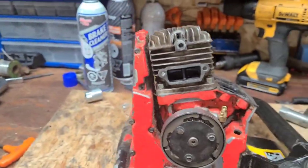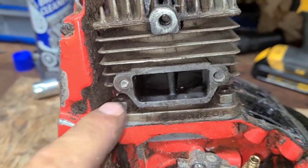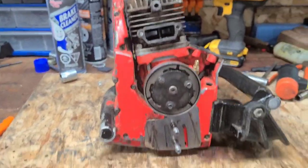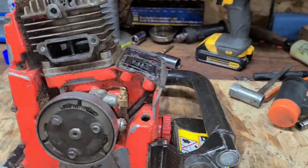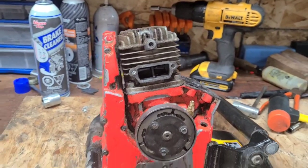We're going to time this thing, and I'll probably pull the cylinder off and then we can decide what we're doing with it. Remember, we have to extract that bolt, we've got to drill and tap this. If this ends up being too far gone — which I'd hate, because this saw runs so good — let's put a timing wheel on this and we can decide what's what.